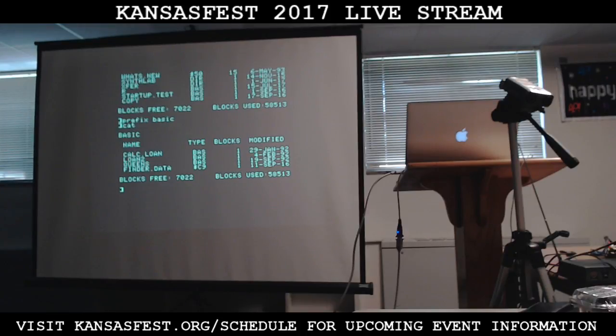It's kind of slow. We'll do a directory of the whole disk, the 32 meg partition, to make it work for a while. I thought I was going to make it work hard. There it goes. So every little line in the border is it accessing a block. That's where it's transferring a block over the serial port. And then again, the number that's printed on the text screen is whether it's from drive 1 or drive 2. And if it writes, there'll be a W up there.